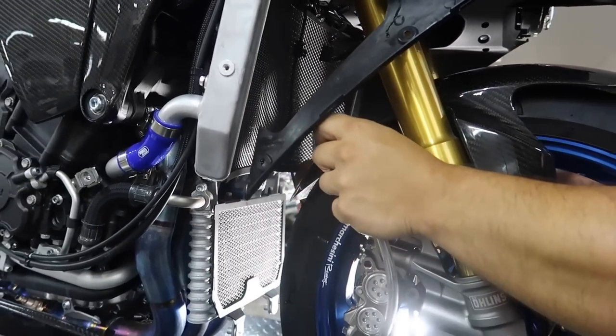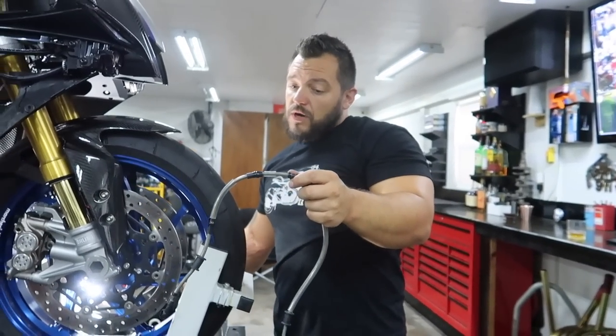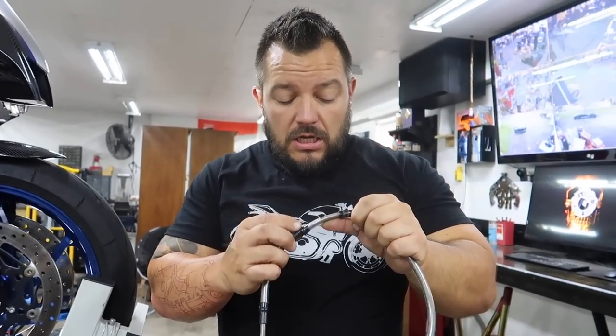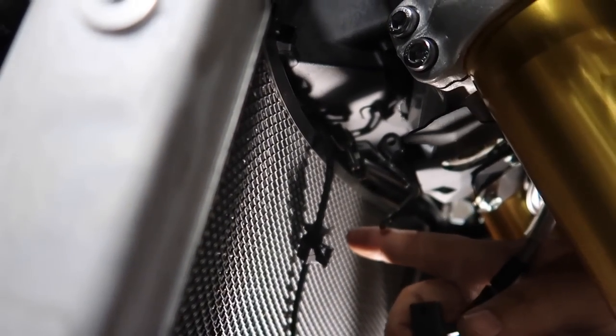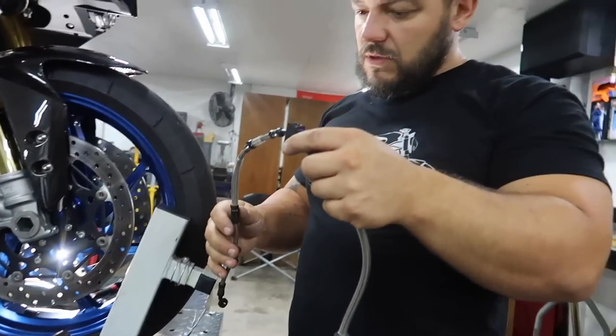He's loosening the last hard line — there it is. That was a bitch to get to. If you guys are planning on doing this at home just for fun, don't. The brake line upgrades are a serious improvement but they are a serious job. Unless you're tracking or doing insane braking, I would not do this. The bracket that holds everything — I actually had to bend it out of the way because you have to drop the entire radiator to get the bolt. The two hard lines are right next to each other and they don't move, so you have to put them in sequence.